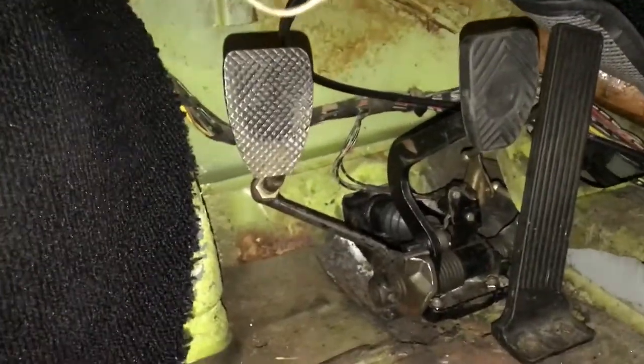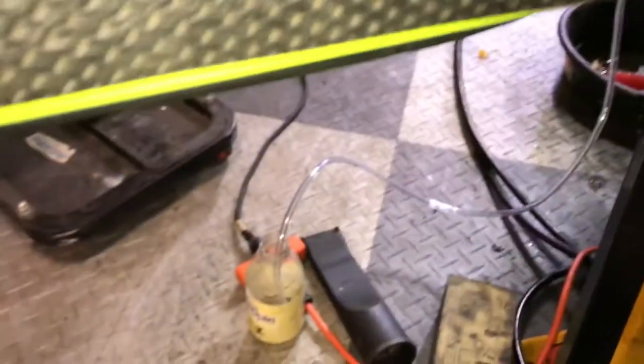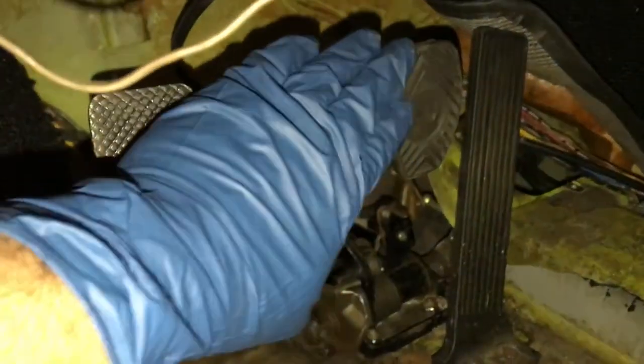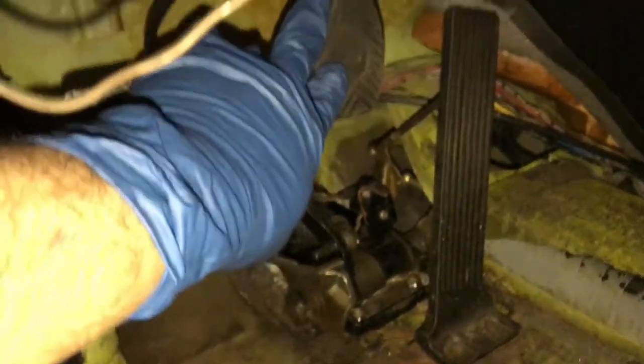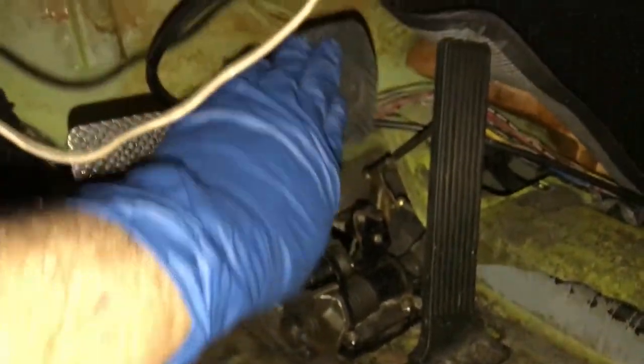Now we come in here to where the brake pedal is. I've moved the bottle so that I can actually see what's going on here and make sure I have a long enough length of tubing. I'm just going to give it a few light taps to hopefully get it flowing. You don't want to push all the way because you can damage the internals of the master cylinder. Some people put a wood block in here to prevent it from going all the way — I'm just being careful.